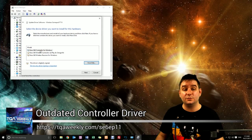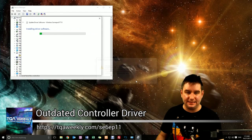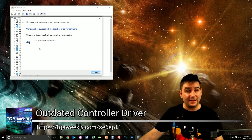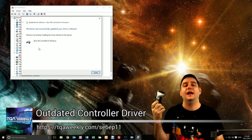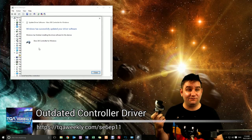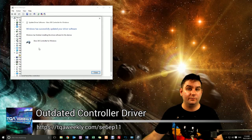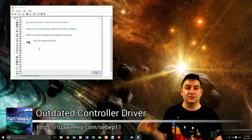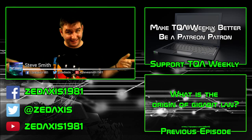Select the Xbox 360 Controller for Windows. I'm warning you — the next window will say that you may break Windows. This is not going to happen, don't freak out, just click Yes. Now it is going to be recognized as an Xbox 360 controller that you can actually play with in Steam and every other platform that supports the Xbox 360 controller — Steam, Origin, uPlay, GOG, whatever you want.